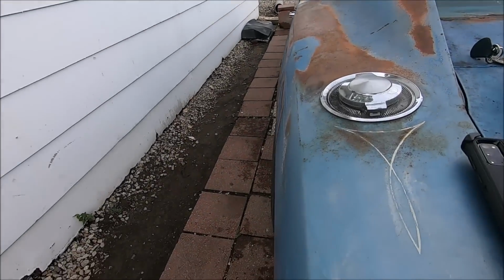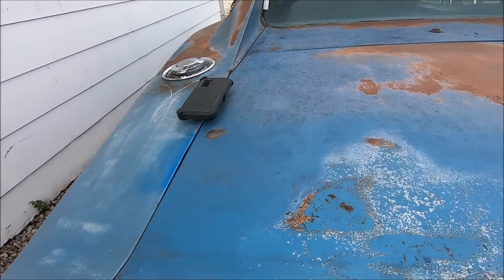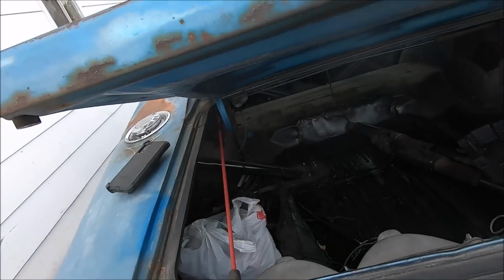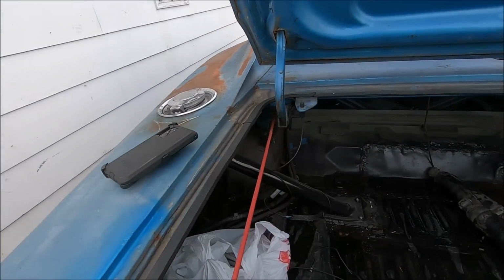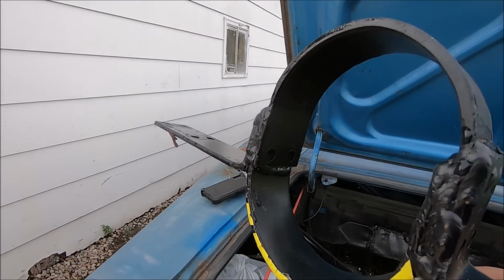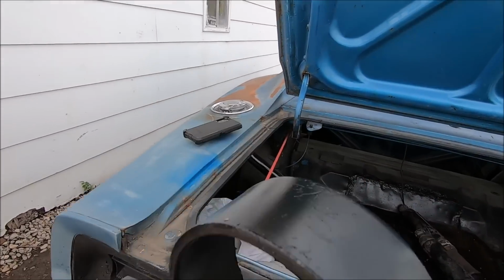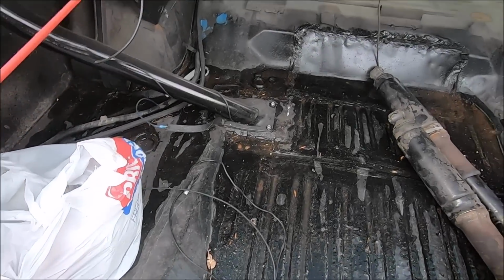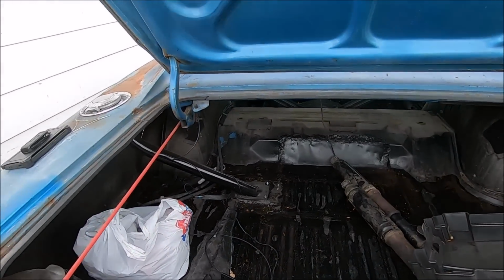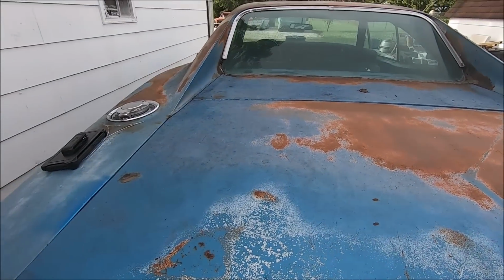If you guys ever watch John from Mad Scientist Garage, we had an issue. You can hear it, a real bad audible clicking sound, and that was the drive shaft safety loop rubbing the drive shaft. So I welded that solid and I got to put it back on, and it's just going to sit back here in Jezebel's trunk that is now a fish tank. That's okay. But that was a fun ride.